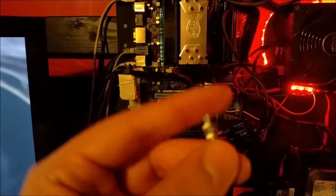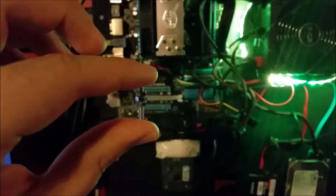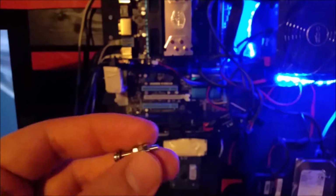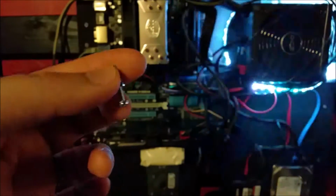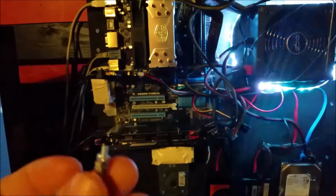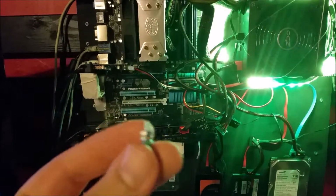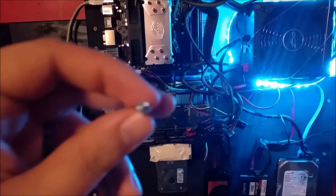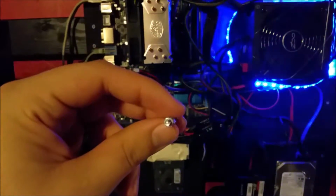This is basically what it is, right? So this is an M3 screw. You can get a good look at that. And this is a longer one. Usually these are really short, but I found some that are longer. What this allowed me to do was, you can see here, this is the setup you want to use, where in the back end you have your washer. You drill that through the board. I used 3 bolts here to separate the motherboard from the wood, and then you put the motherboard on top right here, and you put another bolt on top to secure it. So it sits like this, going through the wood and supporting the motherboard.